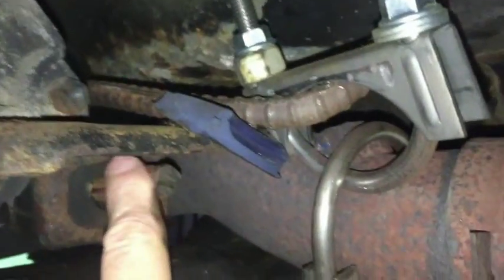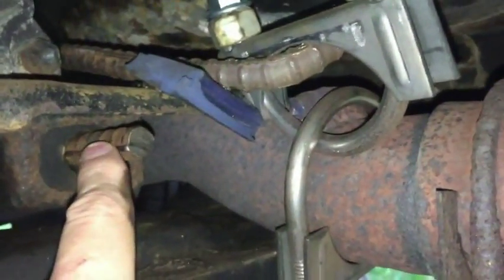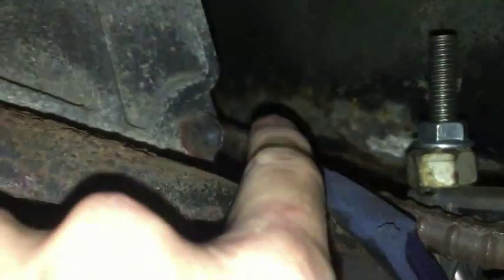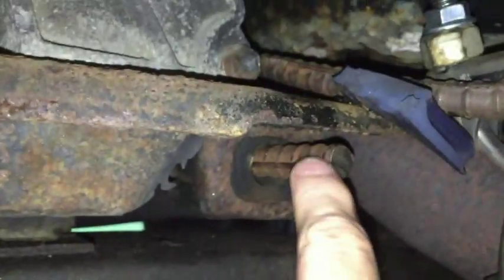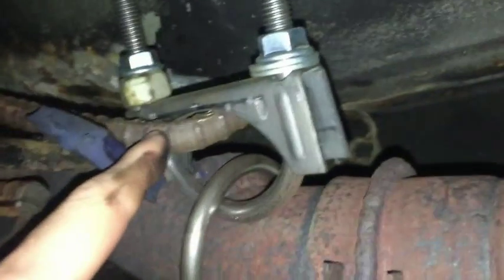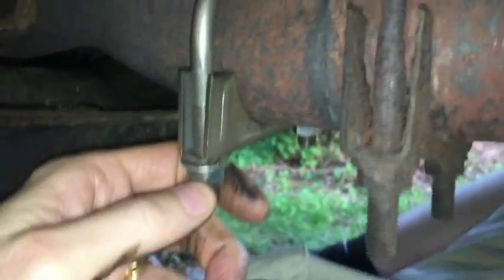So it came in here, and I wanted it to be one piece — I didn't want any piece to fall off onto the roadway and become a projectile. So I wanted it to be secure, and it is secure. What happens is the top piece rides upon this lip of the support. The lip goes out about another inch and a half, and the top of the bar rides on the top of that lip.